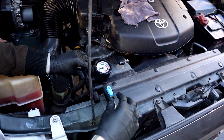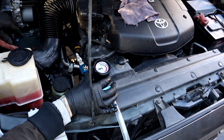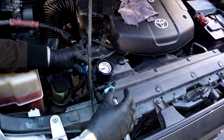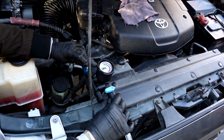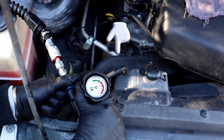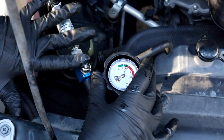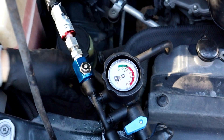I know at this point it seems a little wobbly, but don't worry — once we start placing this thing under a vacuum, it's going to suction right down on there. Now we're going to make sure that this valve is closed for right now. I'm going to apply a little bit of pressure to it before I start putting the system under vacuum. So I've got my air hose attached and I'm holding it down, and now I'm going to press this button and that is going to begin to put the system under vacuum. As I put the system under vacuum, watch what happens to that upper radiator hose. See how it's pretty much holding itself in position now.